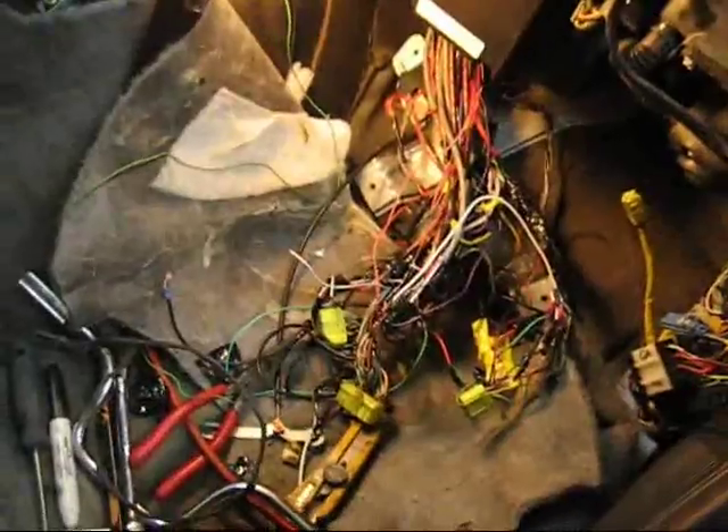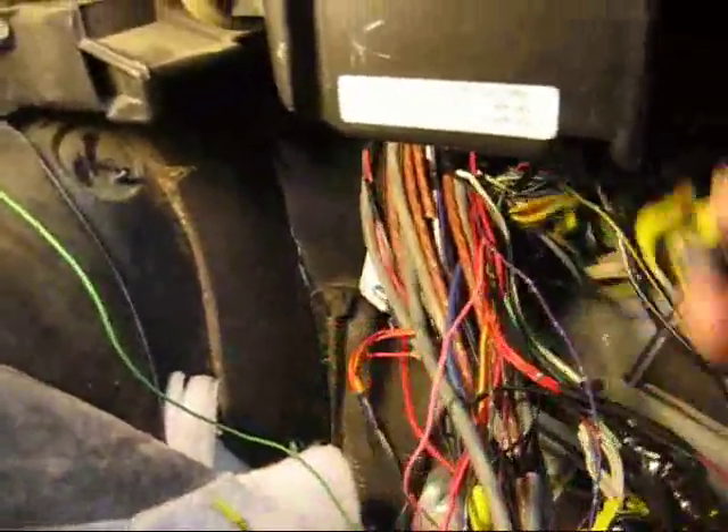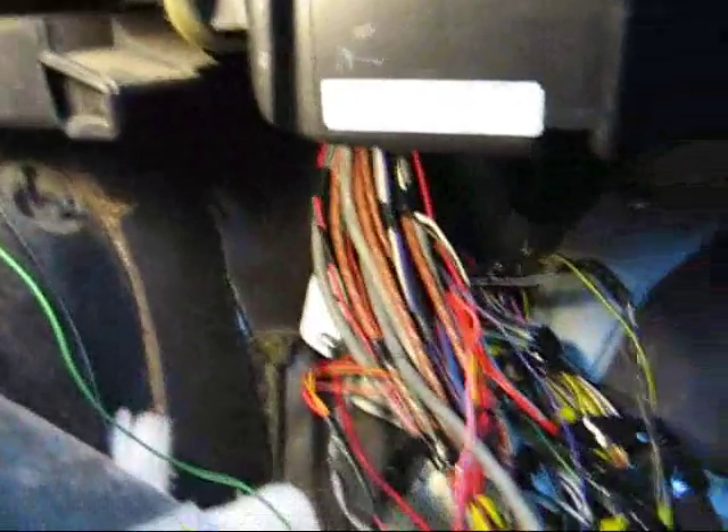Here's my rat's nest — I've got to get on it. As you can see, the previous owner tapped into the original OBD2. Look at this — OBD2. See the difference between OBD1 and OBD2? That's extra wire you don't need. So I've got to get rid of this rat's nest and pull it through the firewall. That black wire up there — I've got to pull it back into the engine bay. And that's about it. This is where the fun starts.